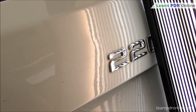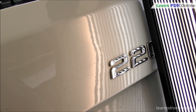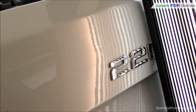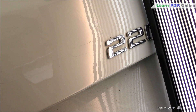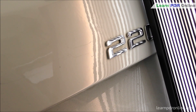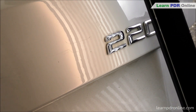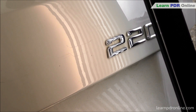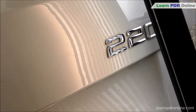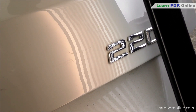We're now working with some micro lows and micro highs. I said I was going to get the left hand side dent to about 90% before switching over to the right - the reason is to get the overall shape right in the panel. The left hand side isn't 100% finished but it's given me enough to know the shape is back. Without taking out that shape I don't know how much of the right hand side is affected by tension and distortion from the left. At 90% I know the panel is in the right shape - I've taken out the crowns, reformed the body lines, lifted the lows, tapped down the highs, and released all that tension. I can then really focus on the finishing stages.